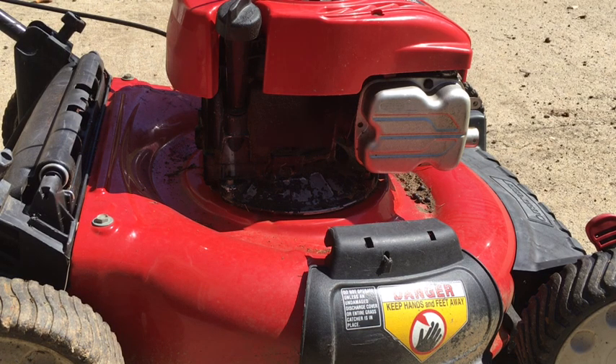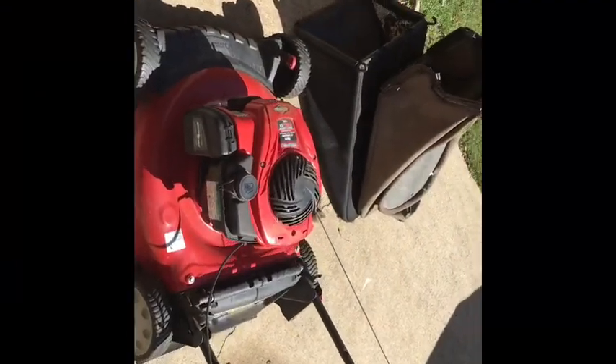Now I've got to do the rest: power wash it, sharpen the blade, change the oil, change the spark plug, put in an air filter. I was concerned the low oil would cause a problem. I ran this lawnmower and mowed my side yard — it did a good job. Now with the engine hot, I'm draining the oil — it's pretty black. I'll put in Supertech HD30 mixed with Supertech oil stabilizer since the oil was so low.